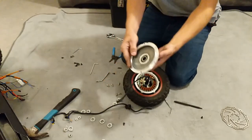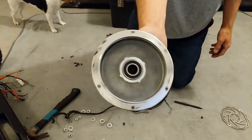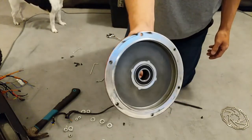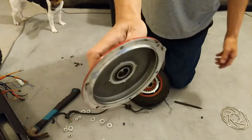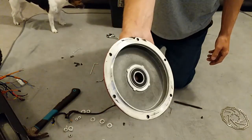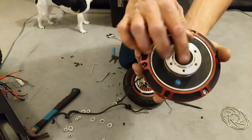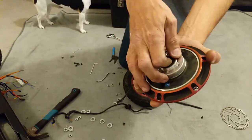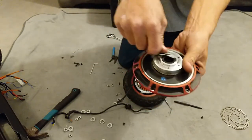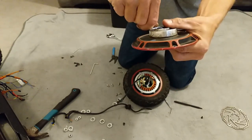What we'll be left with is bearing number one — that's the easy one to get to. That just involves taking the back wheel off, which is a long process but still easy, then popping this cover off. There's one bearing there. The trick is: you'll straight away see a black rubber seal — you want to get that rubber seal out, it protects the bearing from splashes. Don't break it, but it's got to come out.